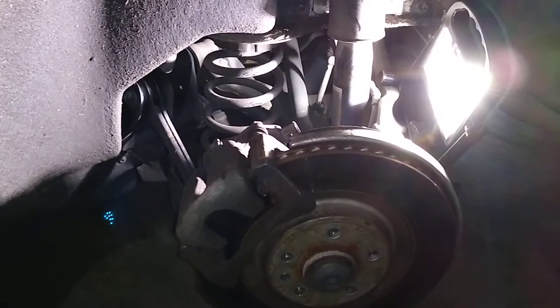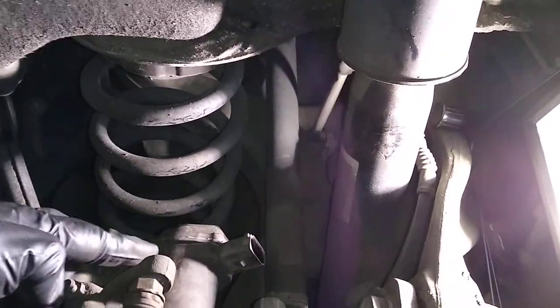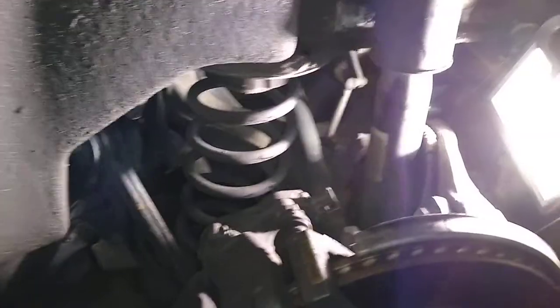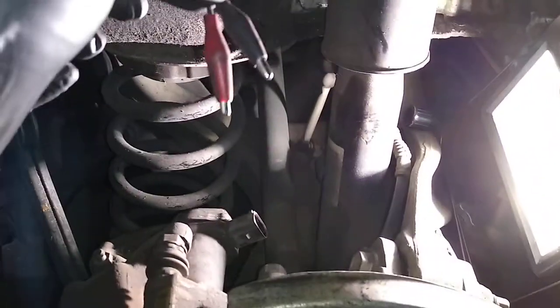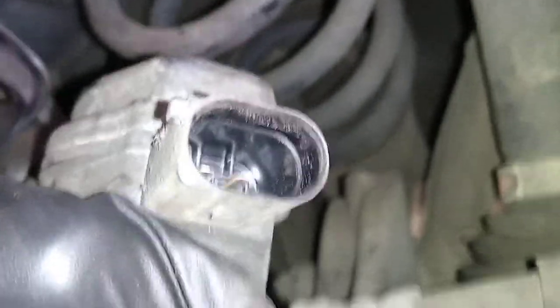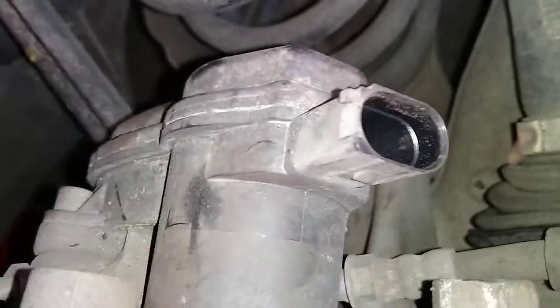What they did was take a 12-volt source and rewind the parking brake motor. So what I did was take a pair of alligator clips, like so, and you stuff them down inside. I don't know if you can see, but inside there's actually two prongs — the left and the right one. I just stuck the alligator clips on there on the inside.